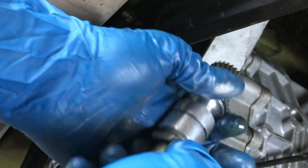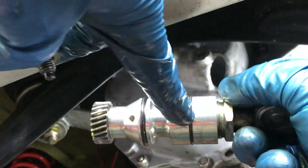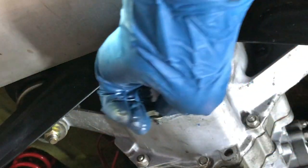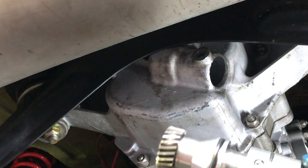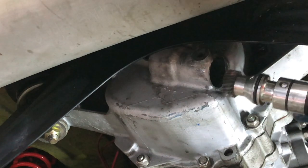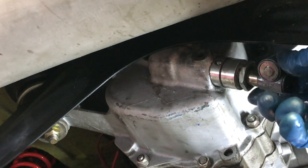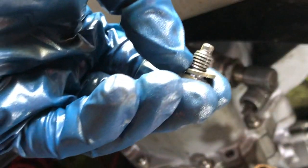Take some gear oil and lube up the O-rings, which will make it easier to get the unit into the car. As you put it in, take notice of the divot — the divot needs to align with the special bolt that locks it in the car through that hole. Orient it so that as you push it in it's aligned with the hole. You have to wiggle it a bit but it does hit home. Take the special bolt and start threading it through the hole. If it doesn't go all the way in, don't force it — the divot probably isn't lined up, so just rotate the drive a bit until it fits, then tighten the bolt.